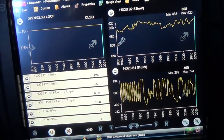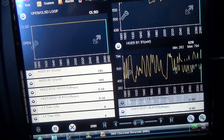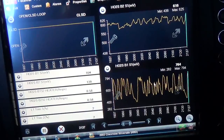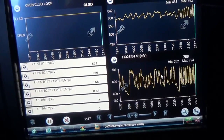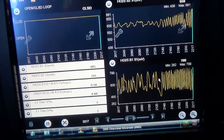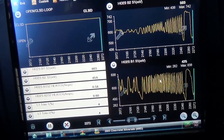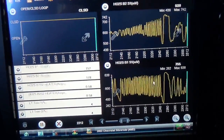Our bank 2 upstream is basically just sitting around half a volt, not doing too much. We can look at our short-term trims - bank 1 and bank 2 are normal, long terms are normal. So this is where our low activity code is coming from. Now as it warms up we can see the sensor tries to wake up. Bank 2 is waking up slowly - they're both old but bank 2 is definitely slower to respond and slower to heat up.